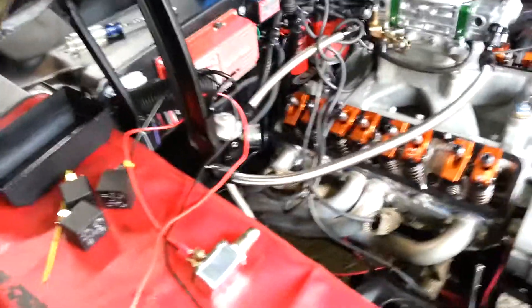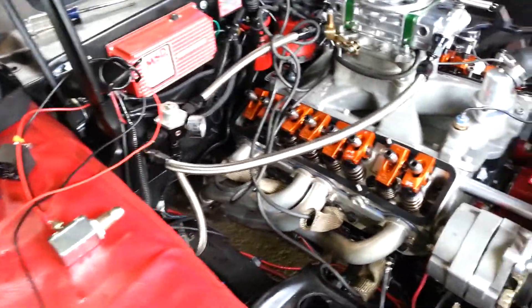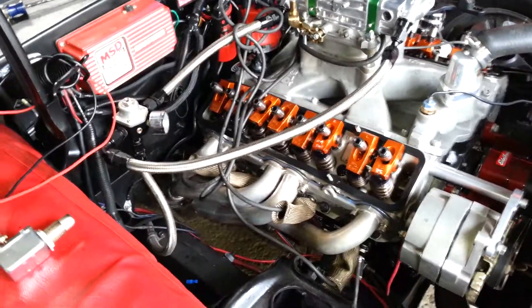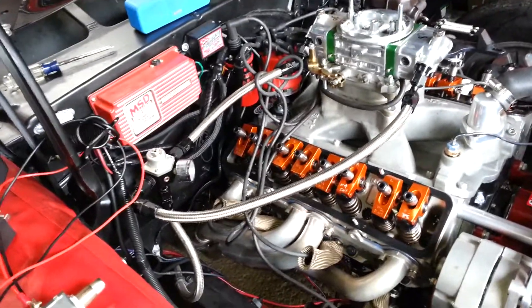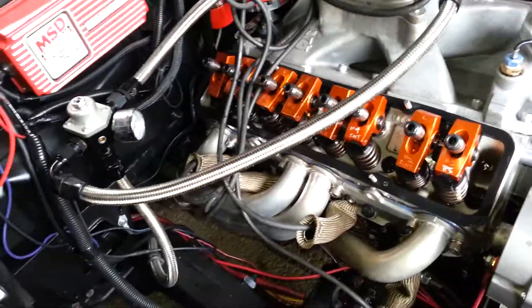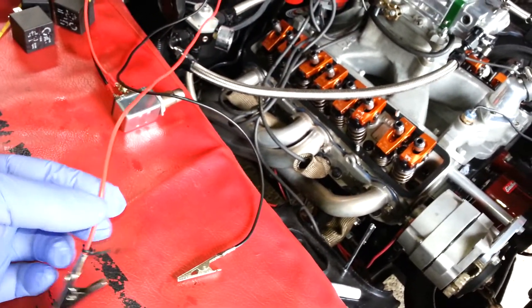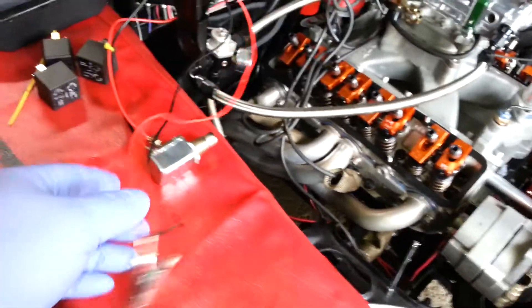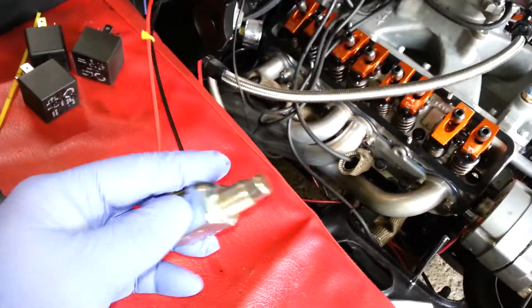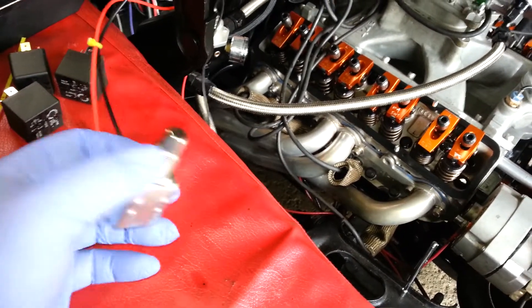I was just doing a little setup here using my bump starter for the ignition on the starter while I'm setting the valves. Usually I don't do a lot of recording when I'm doing this kind of stuff, but if I'm at the track or doing a setup for someone, I always have a homemade bump start. You can go to the store and buy one for 20 or 30 bucks, but these are just two alligator clips on some 14 gauge wire, and this is just a push starter from the parts store — just push this button and it lets power go through both sides.